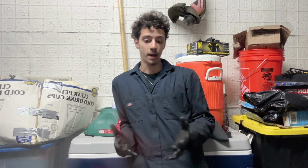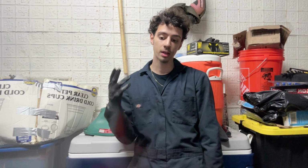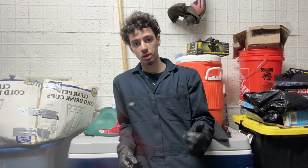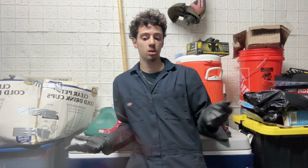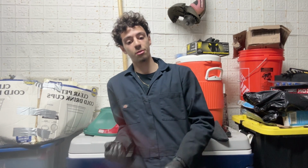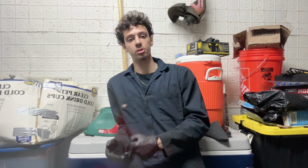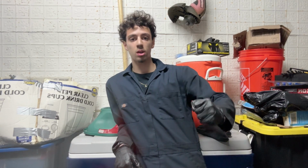So yeah, guys, I never found this video on YouTube. I tried to do it myself. I figured it out, and it's because I kept remembering that when I opened up the new one that I had bought to replace parts, to transfer parts, the gear winded up, the spring winded up just like that. When I opened it up, it was, and I was like, oh, okay, I couldn't figure it out. I couldn't even do a full rotation until I figured out, maybe I could put a wrench. I was trying to get leverage on it, and I put a 10mm wrench on it, and I got the leverage I needed to do a whole clockwise full rotation.